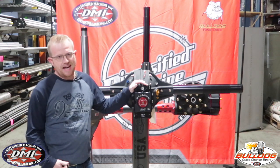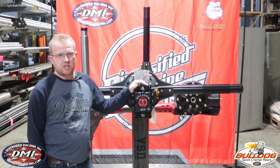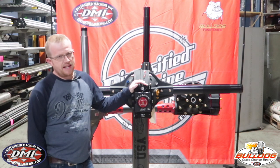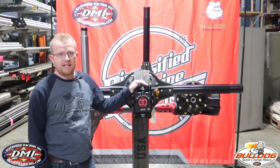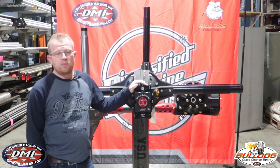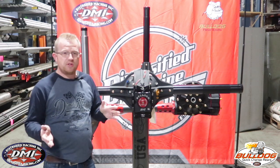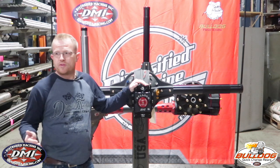We just don't see that. If you talk to us here, we're going to tell you to go with the ring and pinion that makes you most comfortable. The 8 inch ring and pinion is 2.5 pounds lighter than a 10 inch right out of the box. The 10 inch ring and pinion does have the leverage behind it being a larger diameter and will turn the pinion over with less effort. So we feel that when you offset those two things, it becomes a push between an advantage with one over the other.